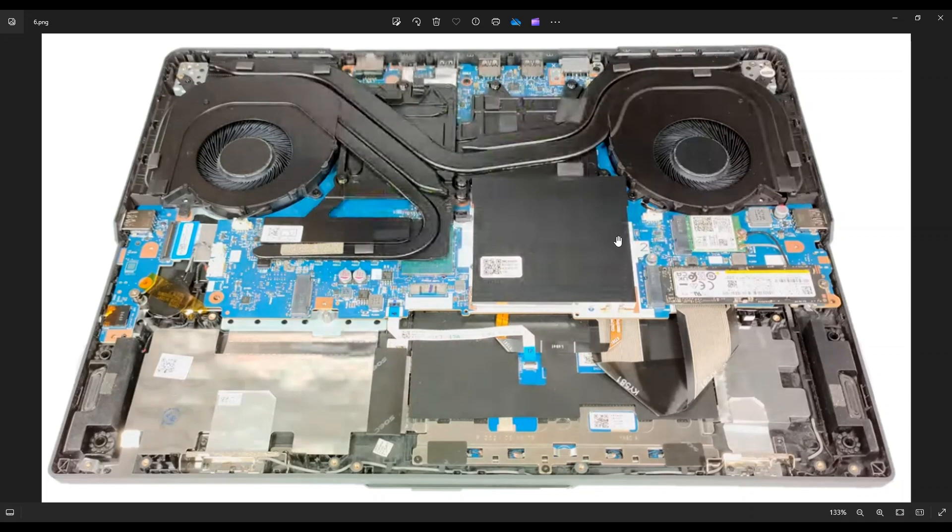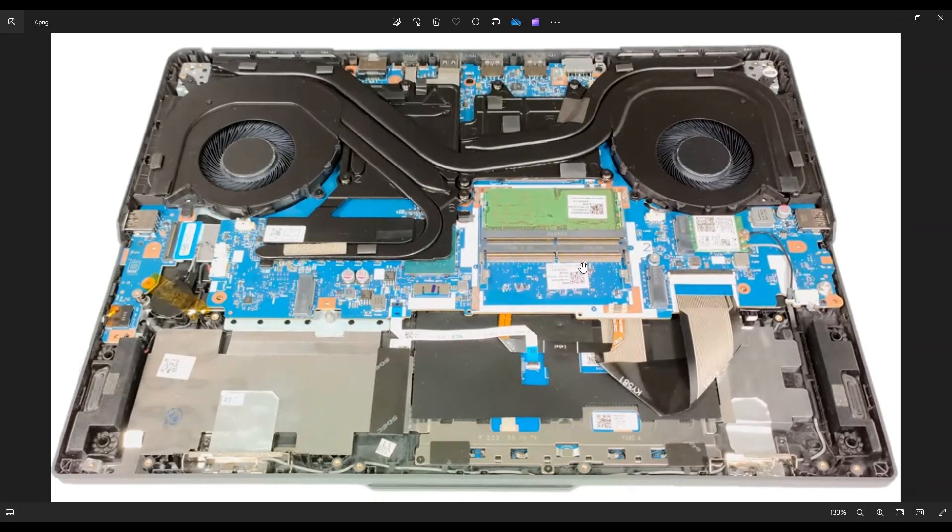Your RAM is located right here under this metal guard. This one isn't screwed down — you can just wiggle it right off, or use a pry tool on the left-hand side to pry it off. You're looking at two RAM ports right there. There's a metal spring-loaded arm on either side of each RAM stick. To get the RAM out, gently pry those arms apart from each other away from the stick — the RAM stick will then release and pop up, and you can slide it out. To put RAM back in, there's a longer and shorter port so it can only click in the correct way. After getting it flush, press down on the center and those metal arms will snap onto it and secure it.